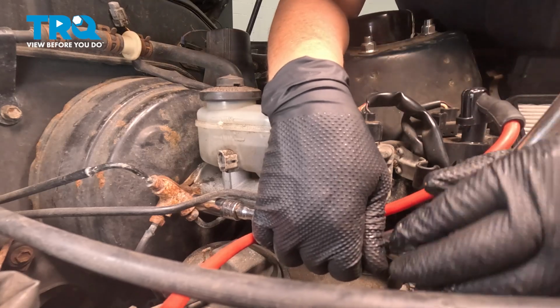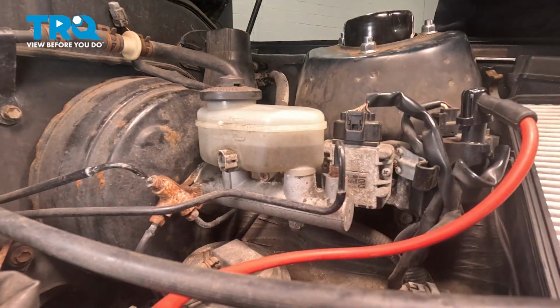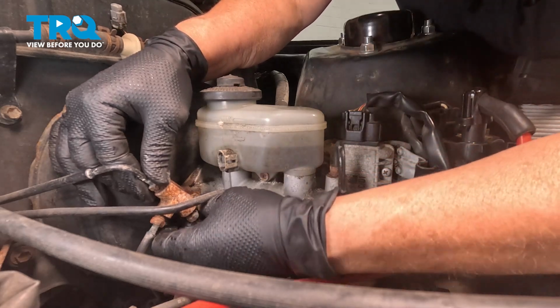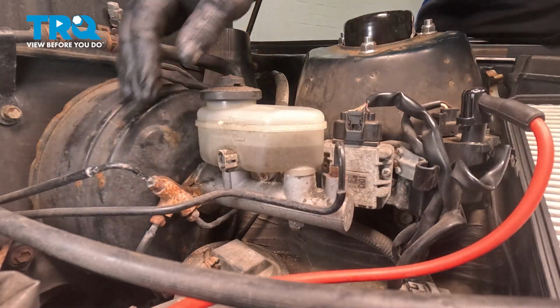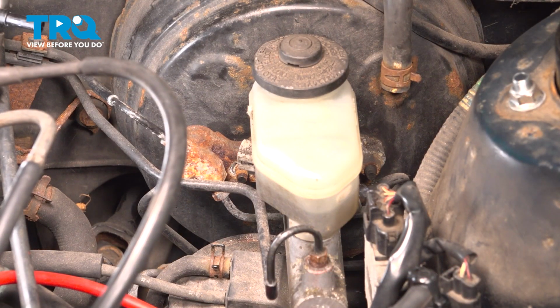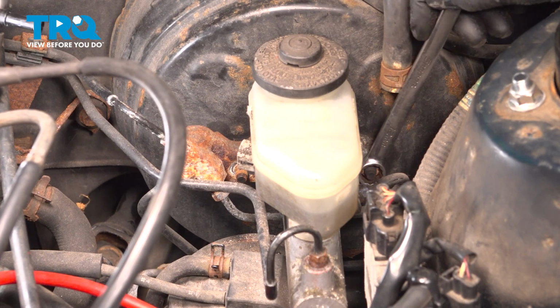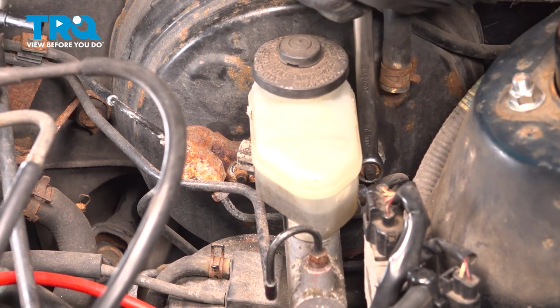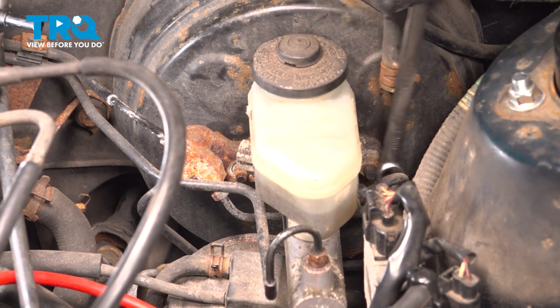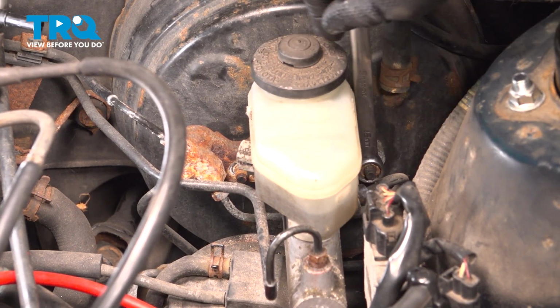Now behind this one, there should be another nut, I'm assuming, because it's just holding on this damper valve. Set that aside. And now over here, I'm going to use a wrench because I won't get that socket in there. So a 12mm wrench. Let's see if we can break it free. Get all the corrosion to come off.